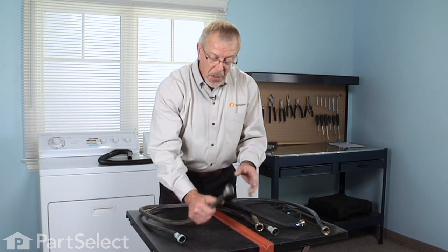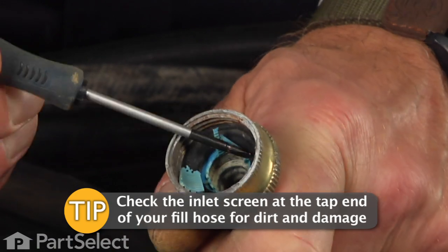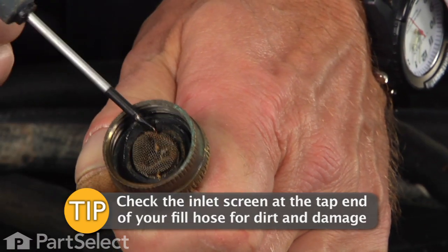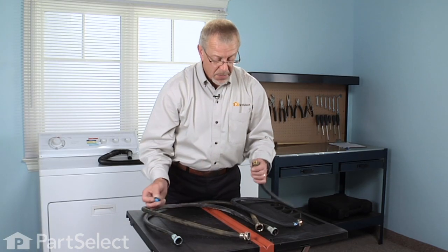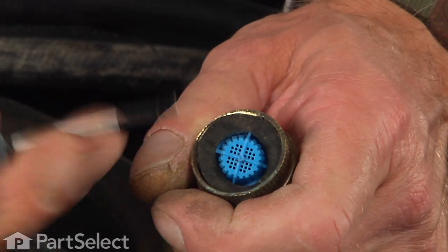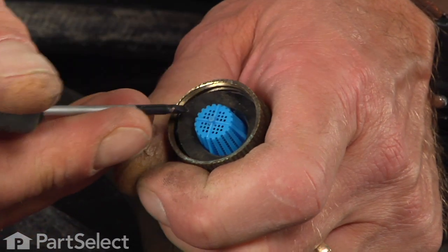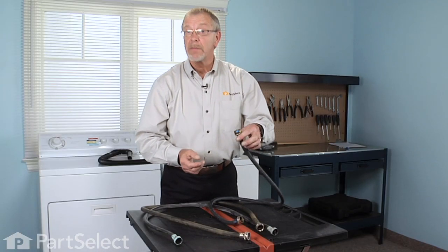While you're looking at those hoses, pull them off and check the screens. There should be an inlet screen at the tap end of your fill hose — make sure it's clean and not damaged; if it's damaged, you need to replace it. They're very easy to do and there are several different styles available. It's simply a matter of cleaning the old washer out of there and scraping any hard rubber residue out, or if you're replacing the hose it will probably come with a new set.